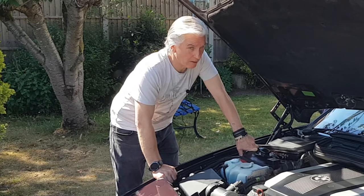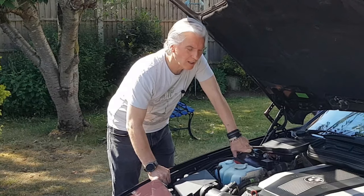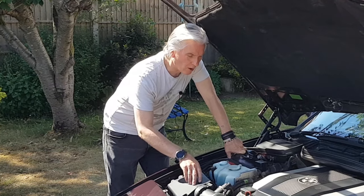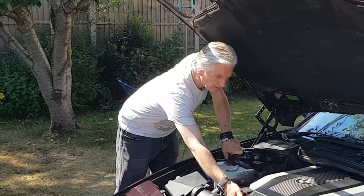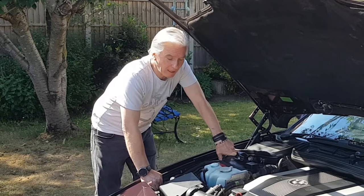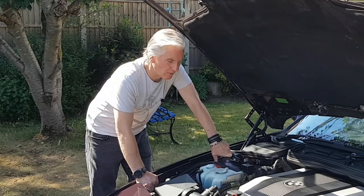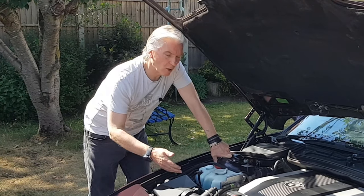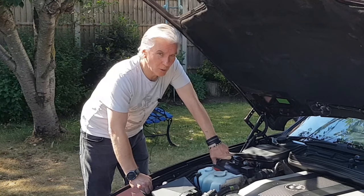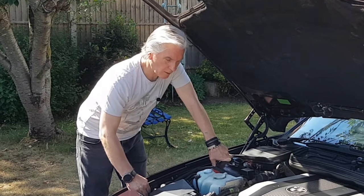It's just you never hear about it because people just imagine there's some other problem with the engine rather than it being over advanced. And it wasn't until the introduction of, of course, the camshaft sensor being an accurate measure of the timing that we actually got to this position where we knew that camshaft A was over advanced. And of course, it's often misdiagnosed as Vanos problems on the M62TUB44 because that seems to be the warning sign.